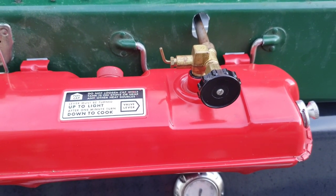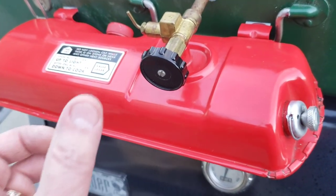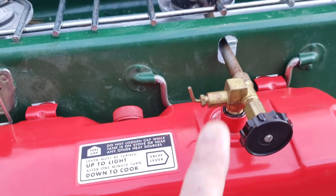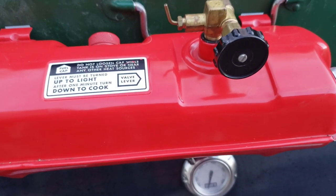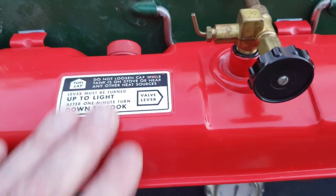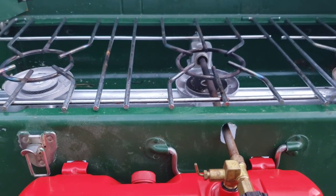It arrived today — awesome looking tool, very solid steel. A dedicated tool just for taking out check valves on Colemans. It's two-ended, so it works on really old Colemans and really new Colemans. It also works on Coleman lanterns — anything that has pressurized fuel. Anything pressurized like a stove or a lantern has a check valve. Gasoline has a lot of stuff that forms varnishes and gummy residue, and it'll stop that little BB from moving. So we're going to go work on this.